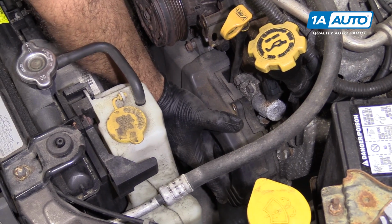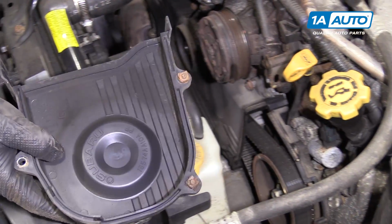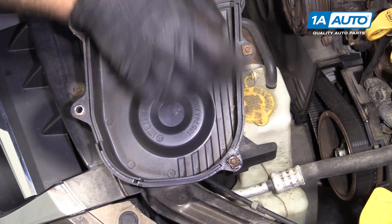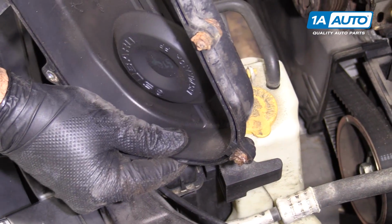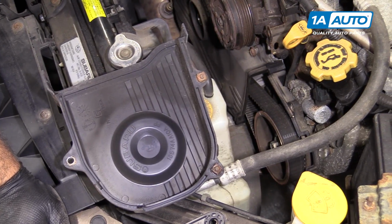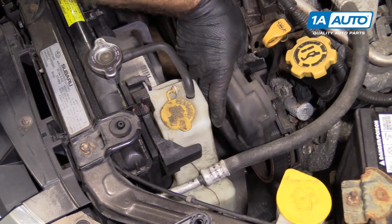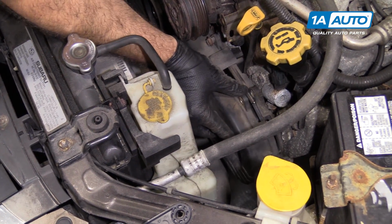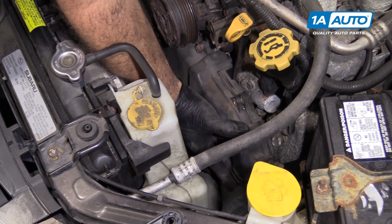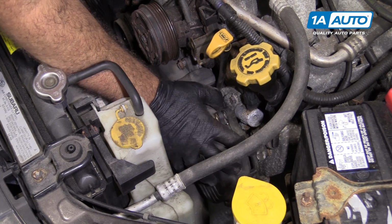Take the cover off. Now it turns out, since this is a rust belt car, unfortunately, the two bottom ones have these little square nuts that are probably into the plastic cover underneath. And because they've just rusted together, they've been broken off. So somebody had done the timing belt on this car before and they're broken in there. You don't really need them because this does have a nice solid fit, and once it's hanging on there, it just sort of slides back on. Get it lined up. And then that single bolt will hold it there. But for now, we'll take it off and keep going.